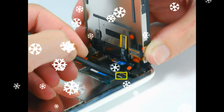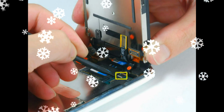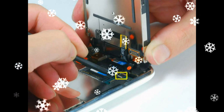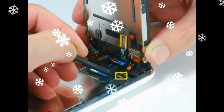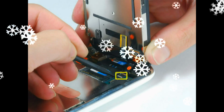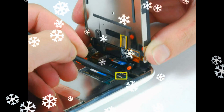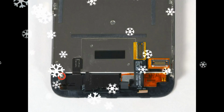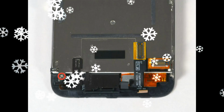Turn the display assembly over and again carefully insert a metal spudger between the two metal rails along the edge of the display assembly. Gently rotate the spudger to lift the LCD up from the glass. Separate the LCD and glass by sliding the LCD panel away from the ribbon cables on the glass. This is what should be left after removing the LCD. If the glass has shattered at the top or bottom, be especially patient and gentle when removing fragments.